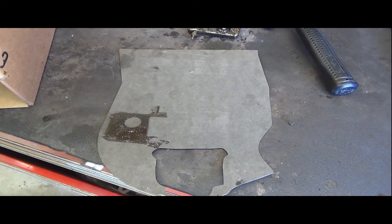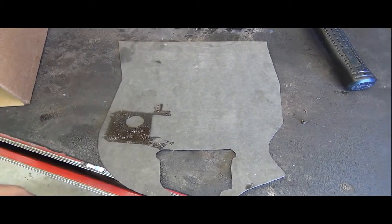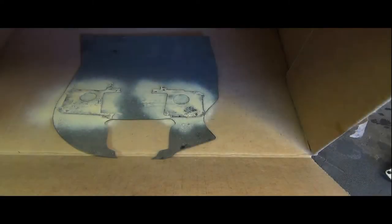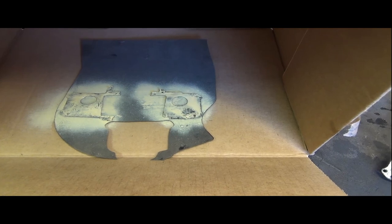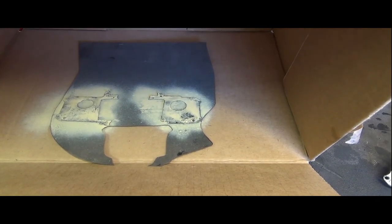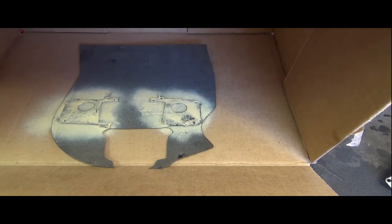So this is about the thinnest gasket material I'll have. I'll just spray paint over the top of this old gasket, and hopefully it'll outline that little guy pretty good. The other gasket is in far worse shape. I wasn't able to get a perfect match on it there, so I'll have to embellish a little bit of parts. But it's pretty close. I'll just cut it a little sloppy to give me some trim room.